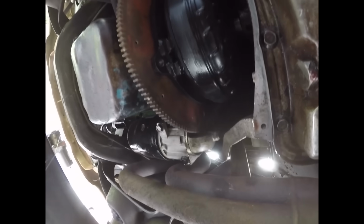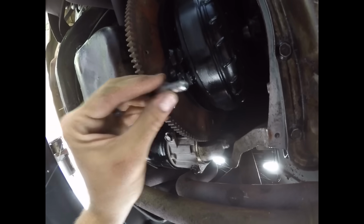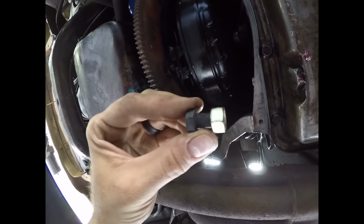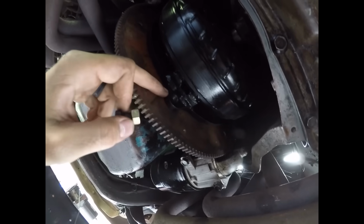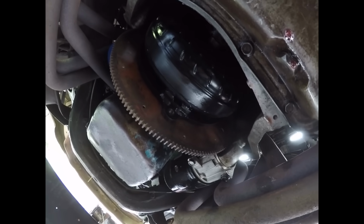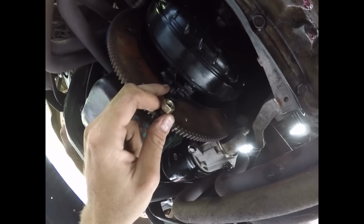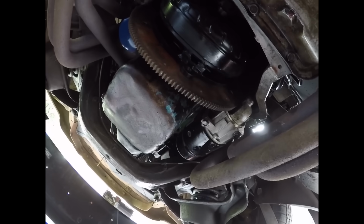Here's where the bolts usually go. This bolt was just jammed through with no nut. This is what a typical torque converter bolt looks like. However, it's too short. For some reason I can't figure out, there's a brand new 4000 stall torque converter in here, which is the extreme wrong application. So I'm going to get a longer metric bolt, put this through here, get all this bolted up, and then we'll fire it up again and see what else we have to work with.